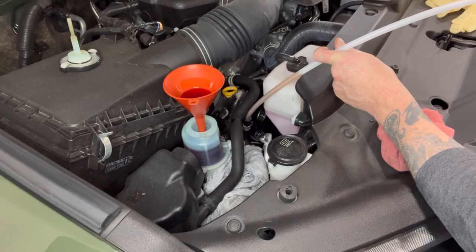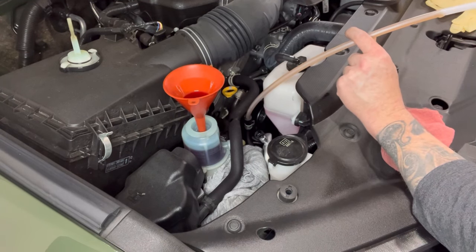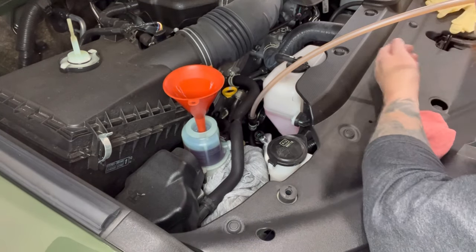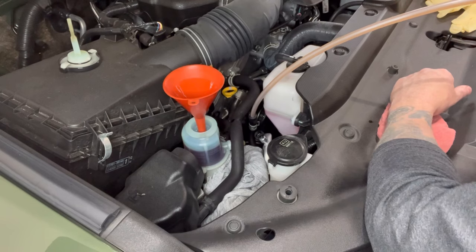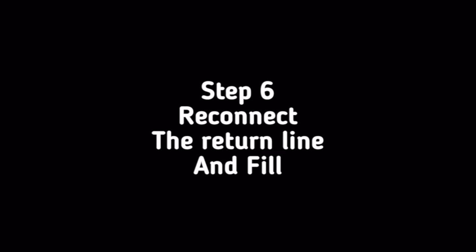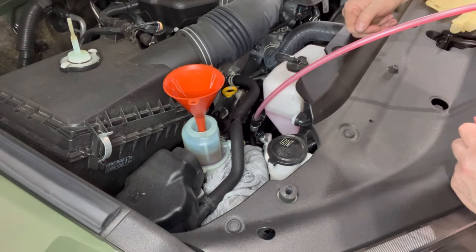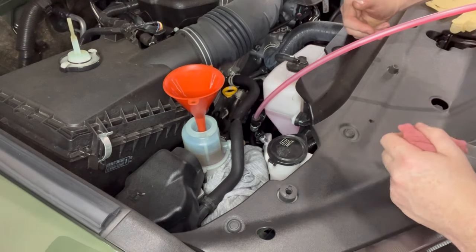As you can see, it's coming out this way and going down that way. I'm using two quarts — please feel free to use as many quarts as you feel you need, but I feel that two quarts is more than enough fluid to flush this entire system as it only takes about a quart in the entire system. I've been at this for a little while and the fluid is now returning back in this beautiful red color, as you see here, which is a clear indication that you have now removed most, if not all, of your old fluid out of the system.